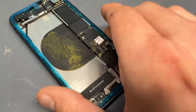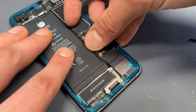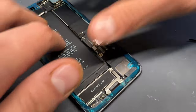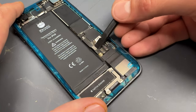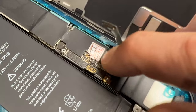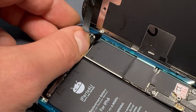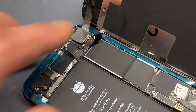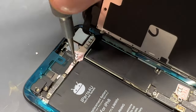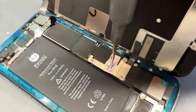Once that's done, we can bring the phone back. Connect the battery flex first and then drop the battery into the cradle for it — that means you're not going to get any alignment problems. Make sure that you disconnect the battery again before you connect the LCD back to the phone and the front sensor. Once all the flex cables are reattached, we can start screwing back down the plates for the front sensor and the LCD, battery, and charge port connectors too.